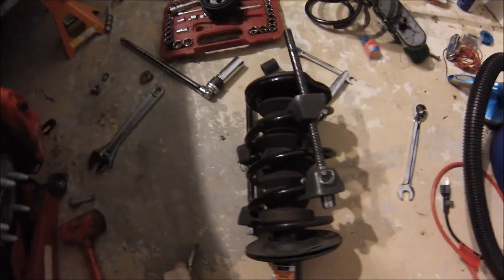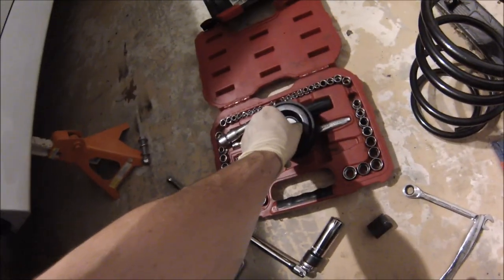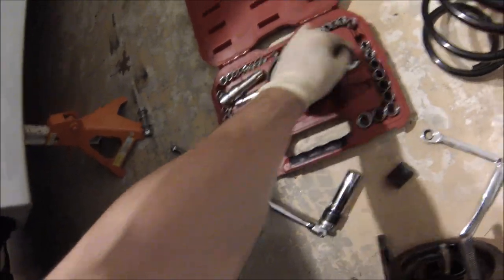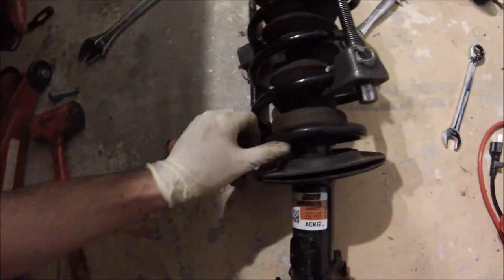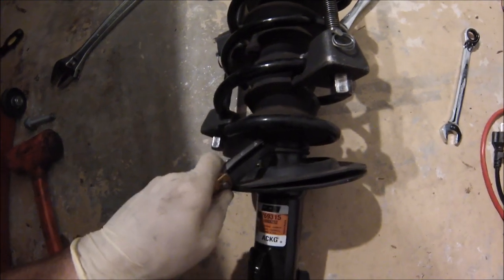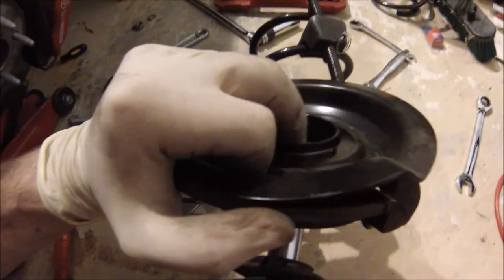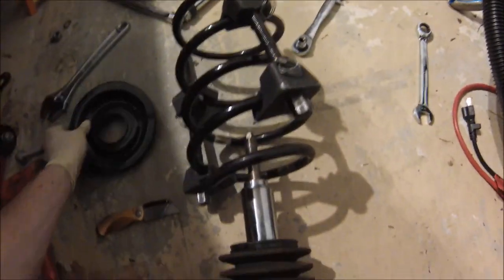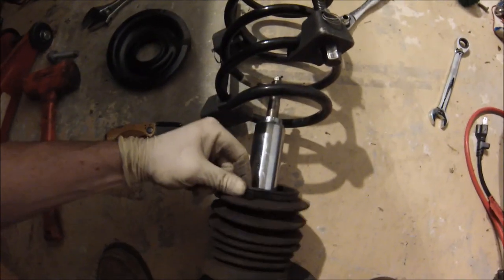We got the spring compressed until it loosened the assembly and pulled the hat off. You just want to make sure you keep the parts right-side up and in order as you pull the hat off — these are the nut, bolt, and hat. I went to pull the shock apart and noticed there's a zip tie around the bottom of the dust shield, so I went to cut that — try not to cut the boot. Things don't always go the way you plan; I pulled on the top hat and it came off, which means the zip tie needs to go back around that bottom ledge. I'll zip tie that back up.